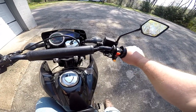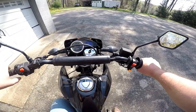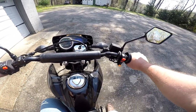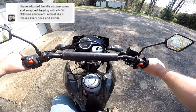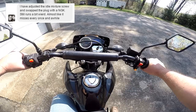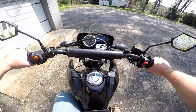No choke — it's carbureted, so you have to hold the throttle slightly just to keep the idle up until it warms up. It doesn't have an automatic choke, which normally would have a little idle kick-up solenoid or something. There's a guy saying it sounds like his hawk has a little bit of a miss to it, but they kind of all do that. I don't know if it's because it's carbureted.